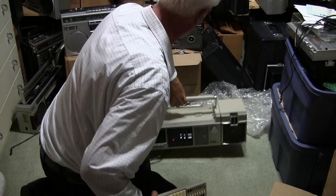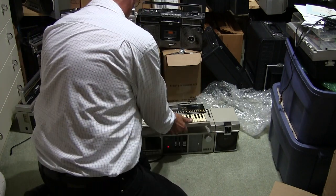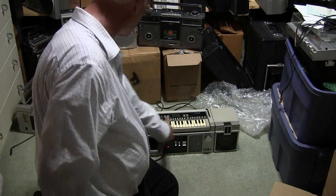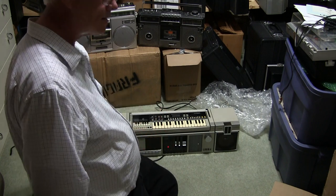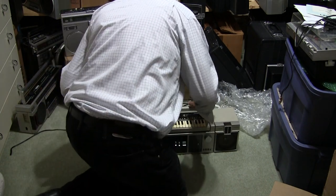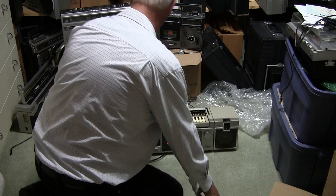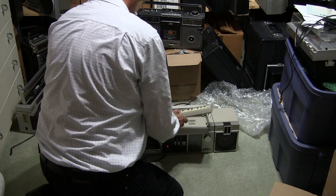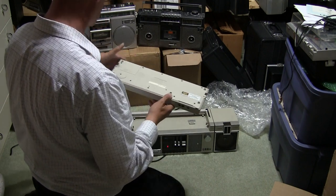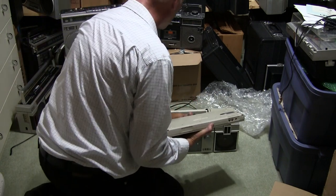Very clean — well, clean considering it still needs to be cleaned. Put the keyboard back on: the little catches right here go into little catches there, just gently sneak it back in place. It gets powered again by this main unit, but when it's not connected it's powered by the five double-A batteries. You go through the line-in patch cord to patch through here. It doesn't have a headphone jack — just line out. I thought it had a headphone jack but I'm mistaken. It's also got a tuning switch. The contacts need to be cleaned but you know how it works.